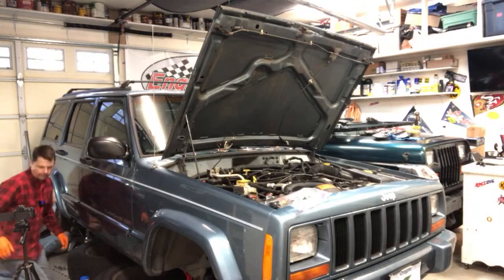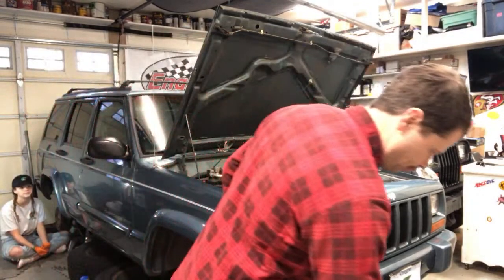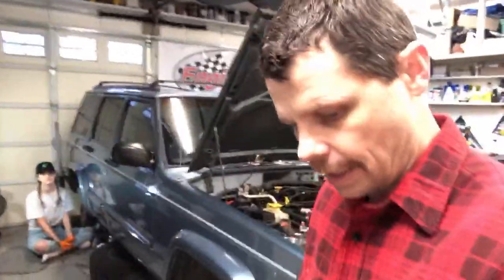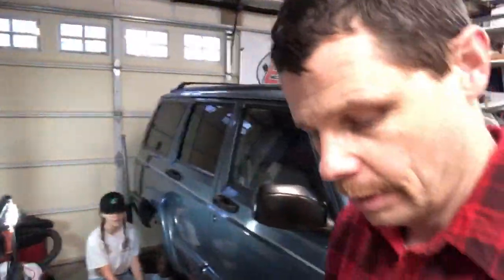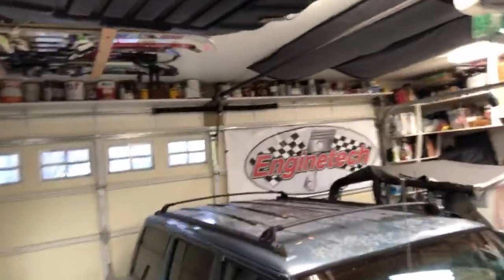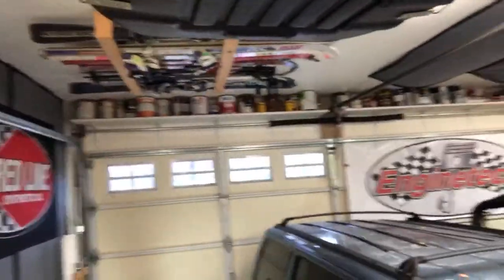So I lift the wrench up. Right. Basically, the premise is I can't let the pedal up when you have that open. That's what we need to watch out for. Because if I let the pedal up when you have that open, it'll suck air into the system.